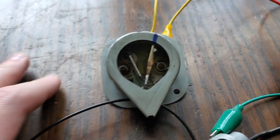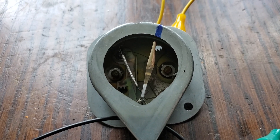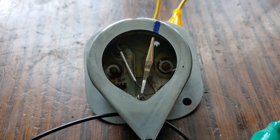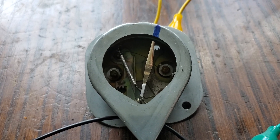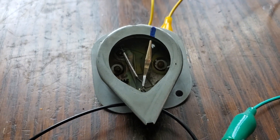And I should mention, I'm not really sure — normally in a Packard gauge, 5 volts is too much for it. However, in this one, this gauge seems perfectly happy to rest at about three-quarters of the way up at 5 volts. I'm not sure if there's something wrong with it or if it's just a different range of gauge, but normally putting 5 volts to your gauge is not advisable.